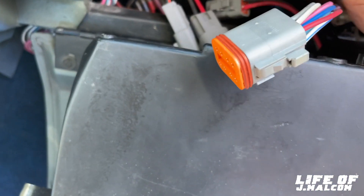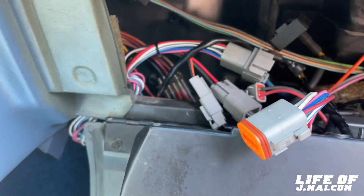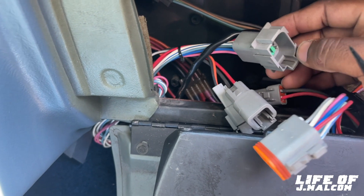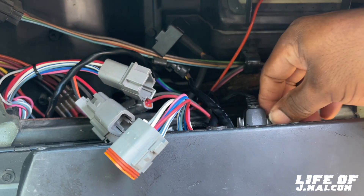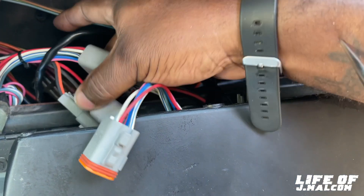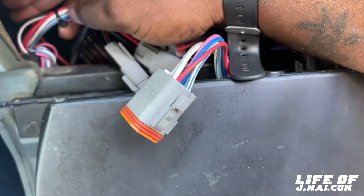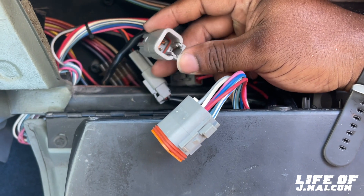So with this box, this ain't your main power right here — this is your main power. Powering your ground. So I'm about to test this one out. Let's see if we're getting signal to the box, see if the box is cutting on. This is your information cable, and this is your data acquisition cable right here. Keep that plug in there where you hook the laptop up. So I'm going to test this one. And if this one ain't getting no power right here, then it's in the engine — it's up there in that wire. If that one right there ain't getting no power, I know what time it is. I really don't see it getting no power, because then I know my box is probably all right.